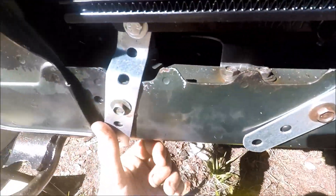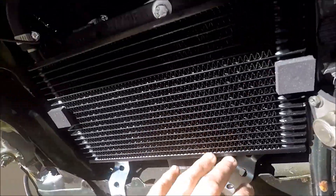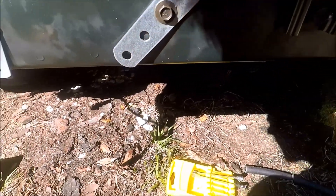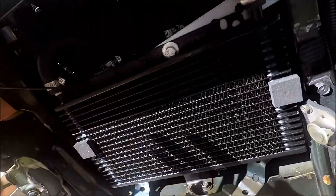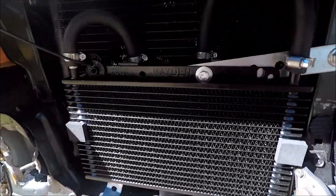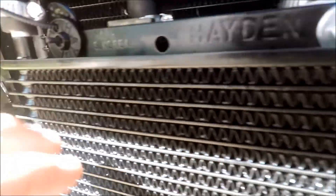That's pretty much it — it's really basic. As long as you can find a way to mount it — I said this was vehicle specific but it wasn't really compatible with this mount here, so I had to completely gut this mount. I'm going to fill the radiator with water since I drained it again, run it, and we'll see if there's any leaks from the tranny cooler. No leaks, no nothing — it's running great, it's getting all cooled.